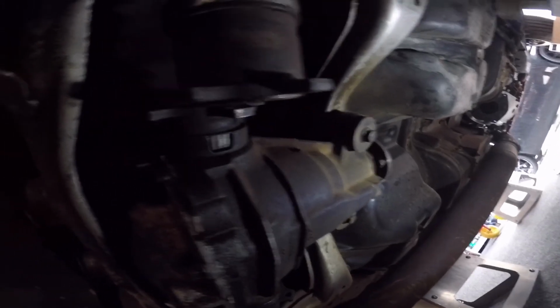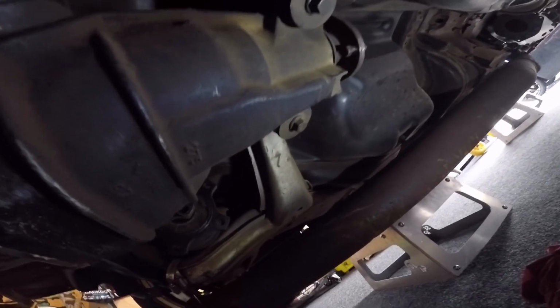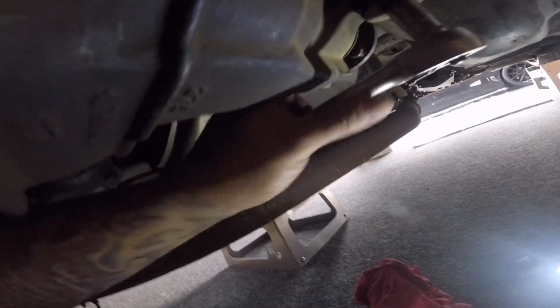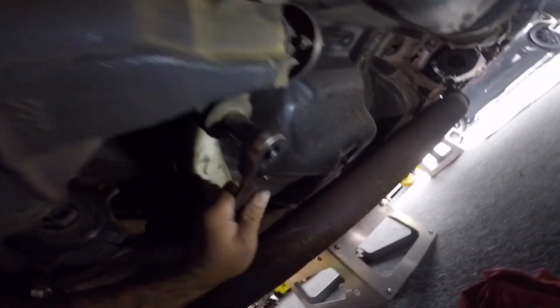Yeah, alright, let's go. So I just took the axle bolts off. When I pulled those out, the boots looked stuffed, I think. I'm the king of using the rattle gun on everything, but when I'm pulling stuff out, especially a diff or something, and all the boys probably do it, I use a ratchet to crack it or to feel before I use the rattle gun, just to make sure everything's tight. Because I could hear a bit of a noise after we had that crash in the back, but I don't know what it is. But yeah, see, that's tight. Yeah, that's tight.